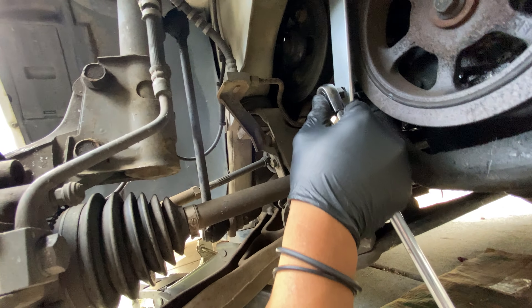That's how you replace it — it's kind of hard to do with one hand while holding the camera. Make sure you align that tab and hole, tighten the bolt, put your belt back on, and that's it. That's how you replace the belt tensioner. If this video helps you, please subscribe. If you have any questions, comment below. Thank you for watching.